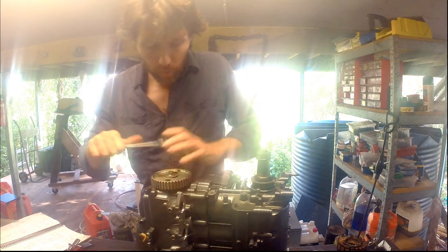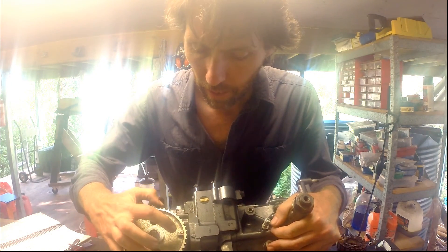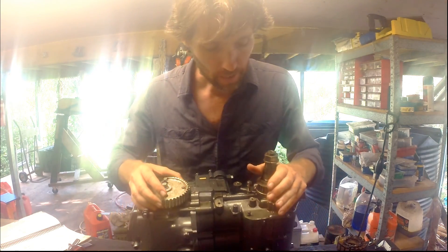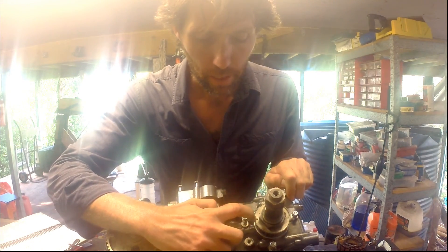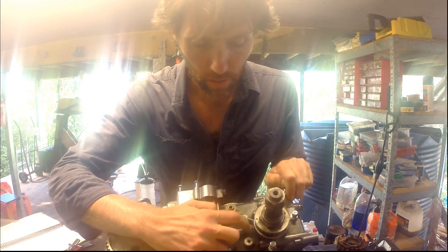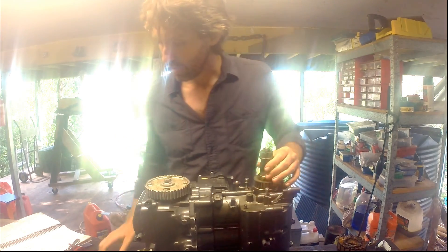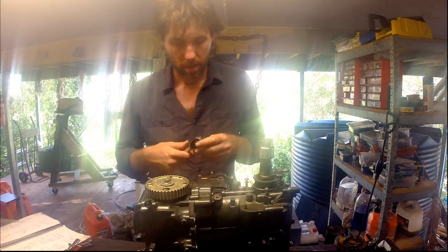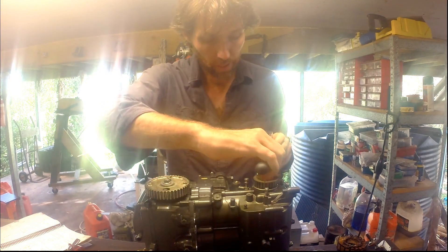What I need to do here is align this number one cylinder mark with top dead centre — so when this is here, cylinder one is at top dead centre. We've got the same here with the crankshaft: when this empty smaller hole is level with this triangle mark here. I'm going to grab a 30mm socket for the nut at the top here.